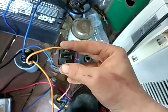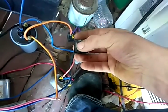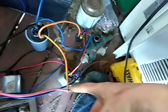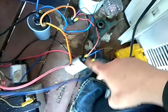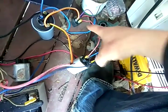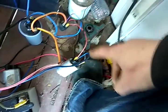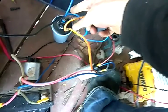This one right here is number 30. The middle one right here would be 87A. We're not going to use 87, which is the top one. The one on the left here is going to go to the positive on your ignition coil and to the positive on your battery. When you hook this relay up with your positive and negative connected, this blue wire also runs to number 30 — that's what makes it oscillate, and you're actually going to get 110 volts on these two wires.